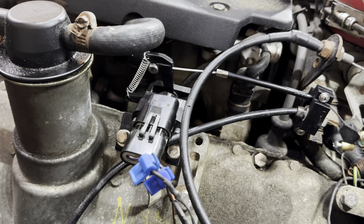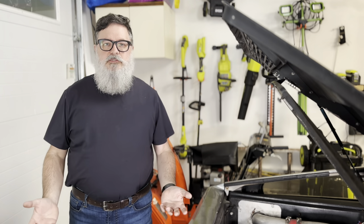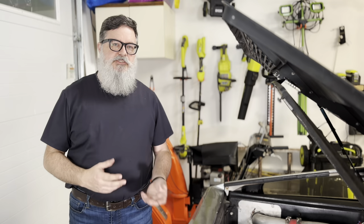And there we go — that's working much better. Now I can turn on other settings like idling when the throttle is below 1%, enabling flood clear support, and I'll have more useful logs as well. I should get better deceleration, acceleration, and full throttle response. Will I notice? Maybe — but then I think the car runs better after I fill the washer fluid, so who knows. And there you have it: a working throttle position sensor. Thanks for watching.